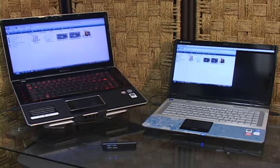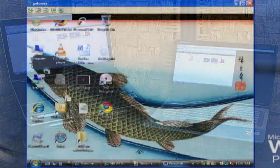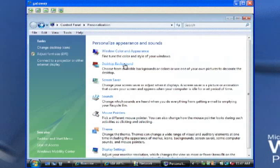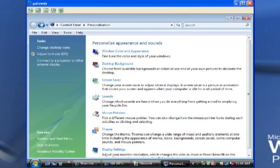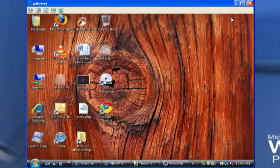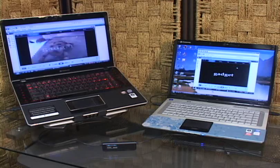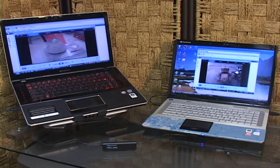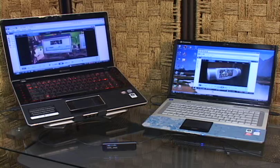For the slightly more mature Ubergeek, this is like an auto-loading, more user-friendly version of PC Anywhere. Video quality is quite perfect — no dithering here. You'll see exactly what is seen on the remote computer, though there is a slight lag between the local and remote stations. You definitely will not want to do any timing-sensitive functions or run video through the CS661, but it works just fine for everything else — from networking to web browsing to word processing.